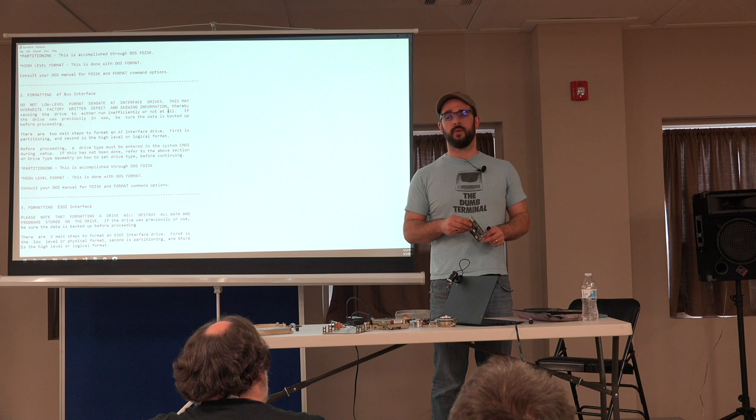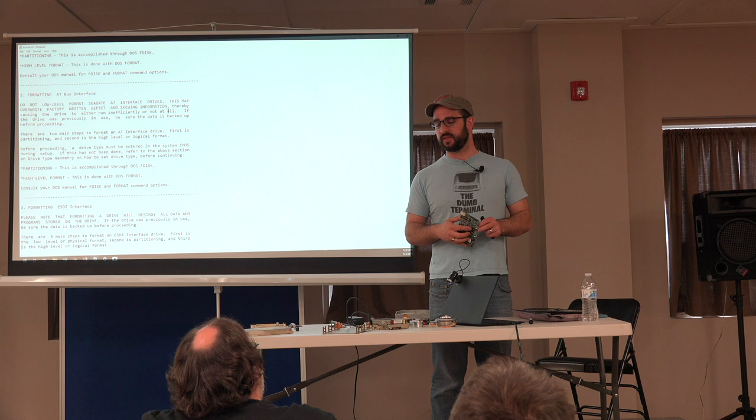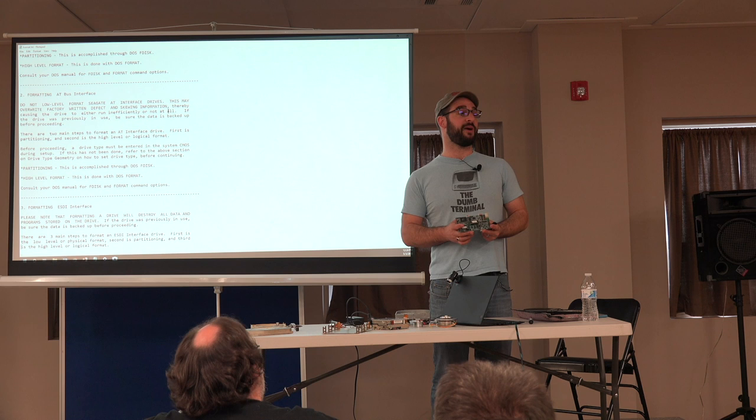But anything with a servo platter or pretty much anything that's voice coil, you're not going to be able to. So I guess fortunately now there's a number of solid-state options you can get that replace a SCSI disk with an SD card or CF card or something like that. So you can keep the machines going, but unfortunately keeping that nice rocks in a blender sound going is not always possible.